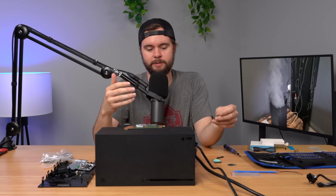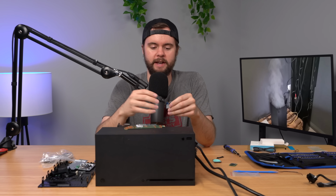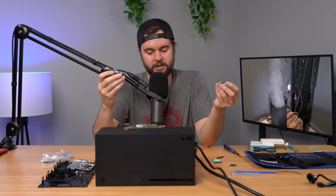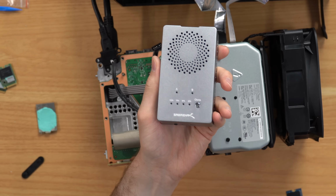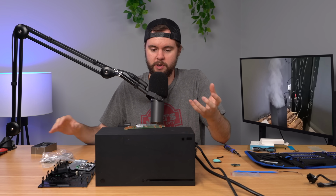I've tried it like 20 times. I watched different videos, I watched different tutorials. They're all essentially the same, where you use this program called Macrium Reflect. You get the image from this partition here, and you clone it to these drives here, and it just didn't work for me. I also tried cloning the entire original drive with this little Sabrent cloning tool that I saw on Tronics Fix. I saw him use it once, and I tried that. Did not work.